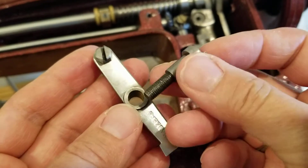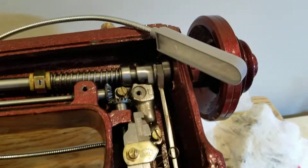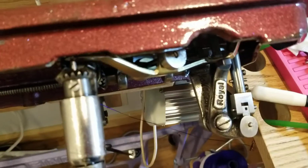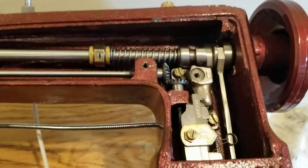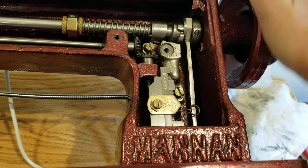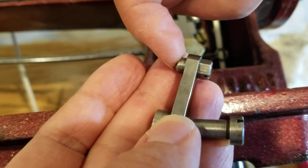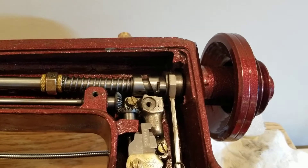So this is the screw — it just goes in there and this whole thing just screws into your machine. Here we are with the stop-motion removed. You don't need to disengage the spring with the cardboard underneath unless you want to. I have found that sometimes I just don't like the pressure on the handle, so I will have the stop-motion disengaged. When you disengage the stop-motion, this channel has freewheeling — for lack of a better term — there's nothing mechanical. Before, this little nubbin up here was riding in this channel. I prefer to take it out so there's just less parts rubbing.